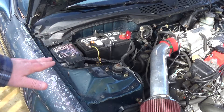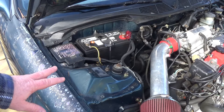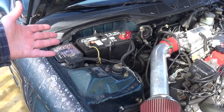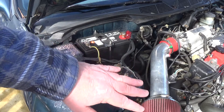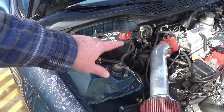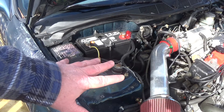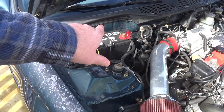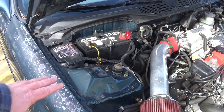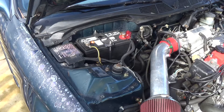Between the age of the battery telling you what it is, and if it was like 12 volts coming up, then something's wrong. Hopefully I just need to charge the battery up. Let's say it was reading 12 even right now — that's a little bit too low. Or if it was reading like 11, that's way too low, and what will happen is you'll make your alternator work too hard to charge the battery. A bad battery can burn up a good alternator, and the reverse is true too — a bad alternator can burn up a good battery. So you want to make sure they're both good. The alternator was putting out 14 volts — that's looking good — and 12.6 is a pretty good base range for a battery, so that tells me this battery is good.